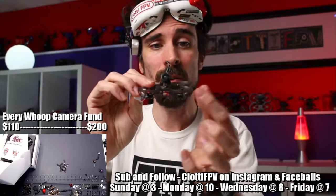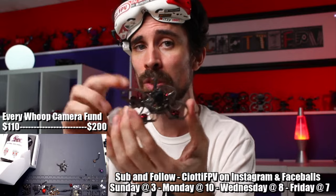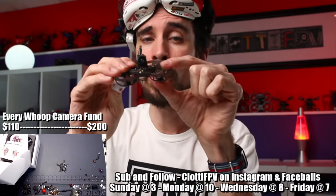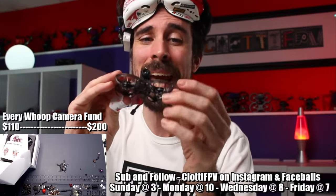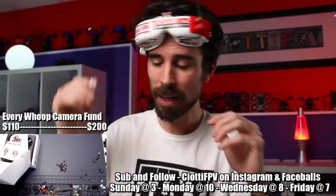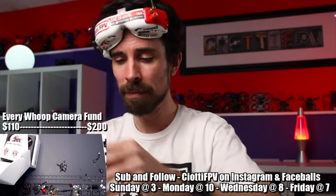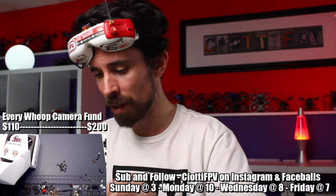The front motors always take more abuse than the rears. So it's on the front, and the propeller was up on the motor shaft. That leads me to believe that I might have smacked it and bent this motor shaft just ever so slightly. Not so much that it's going to really affect the way this thing flies, especially because it's on a pretty tame PID tune.